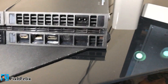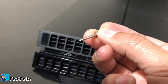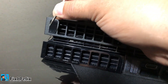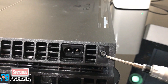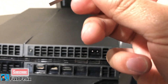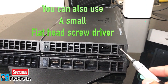As you can see, the one in the middle says 'Warranty Void if Seal Removed or Damaged,' so again, this will void your warranty. We have to remove these three stickers — this one, this one, and this one. It's really easy; just use something small like a flathead screwdriver to pry them up. Then remove the three screws using a T8 Torx bit, which you can find at Walmart or a hardware store pretty cheap.